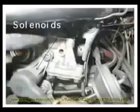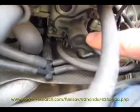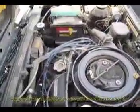I also added a fuel pressure regulator to help prevent flooding, as described in my carburetor enhancer book. Underneath here we have a fuel shutoff valve. In this particular carburetor it allows you to actually shut the fuel off from the carburetor. This is normally an anti-dieseling valve, but since it's electric, it's easy to hook into my deceleration fuel shutoff circuit built under the dash. That allows me to shut off the fuel from the carburetor — it doesn't affect the fuel in the float bowl — any time I want. Obviously with an old carbureted engine like this, that's pretty obsolete technology, but those are the fuel savers I have on this particular car.